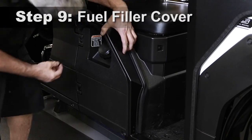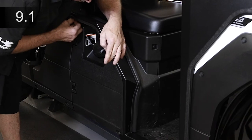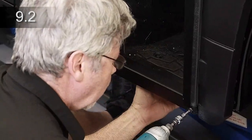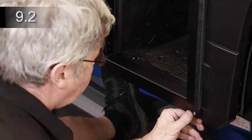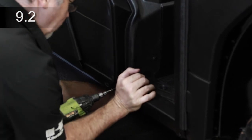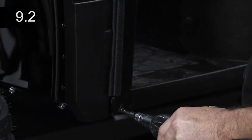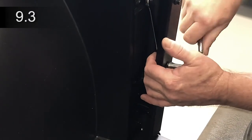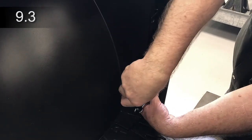Place the fuel filler cover panel onto the right B-pillar and insert two bolts. Align to the side of the B-pillar and tighten the bolts. Place the front flange of the fuel filler cover against the lower flange of the A-pillar and install a self-drilling screw. Install a second self-drilling screw through the hole at the rear of the lower flange of the fuel filler cover. Install a self-drilling screw through the lower flange of the A-pillar on the driver's side. Tighten the two bolts holding the lower tab to the A-pillar and tighten the lower bolt to the vehicle door hinge mount.